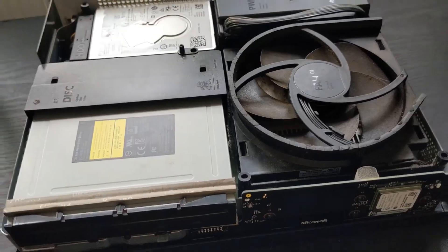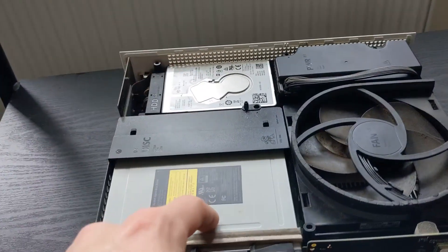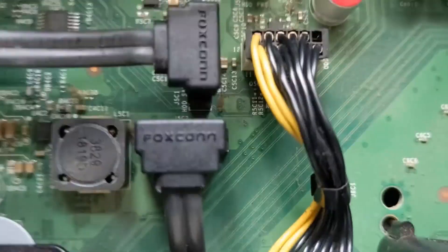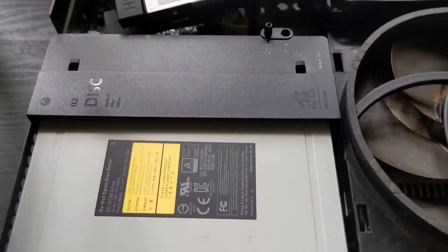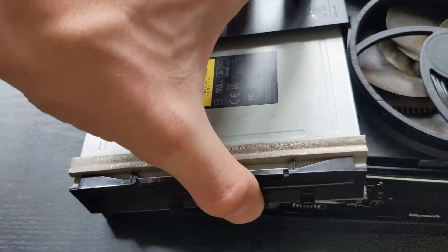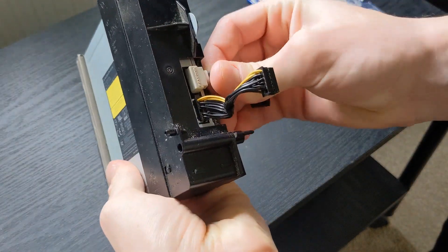Once you've got to this point where you've got your power supply, your fan, your hard drive, we're going to pull up the hard drive, grab it, pull it up, and take off the SATA cable and this little cable here that are both connected to the disk drive. There may be some screws you have to undo — I've had the thing open for ages and forgot — but then you're going to take out the disk drive like so.